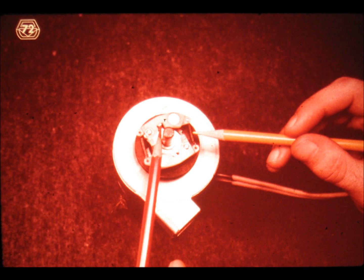Slide number 72. When the motor is at rest, the spring indicated by the yellow pencil causes the motor clutch pawl to rest against the lug pointed at by the red pencil. By forming this lug in or out, it is possible to adjust the clearance between the heel of the pawl and the tooth of the motor pulley. This clearance should be kept between 1/4 to 1/2 of 1 millimeter.